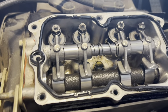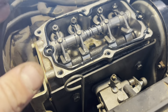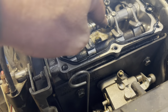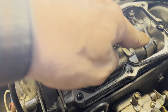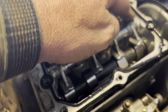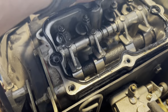There's your cam and there's your lifters. When you pull this cover off, there's a plate right here — when you pull that plate off, your cam will just slide right out this way, easy as possible. Then on this rod that's holding your rockers and lifters, I pinched them like this and pulled, and it just slides. You've got a rocker, then a spacer, rocker, spring, rocker, spacer, rocker.